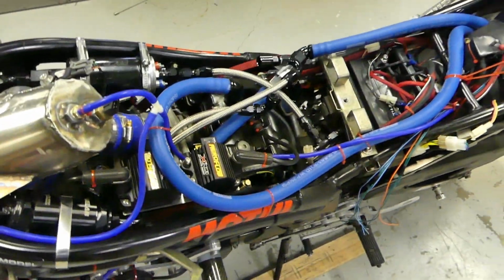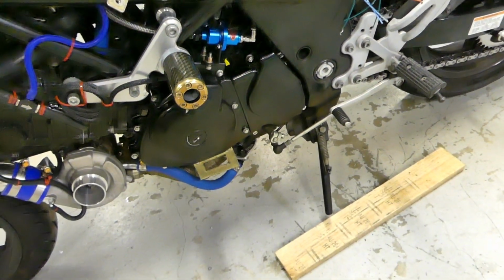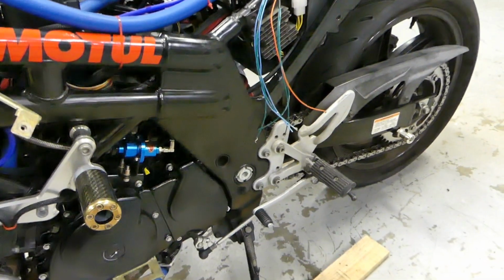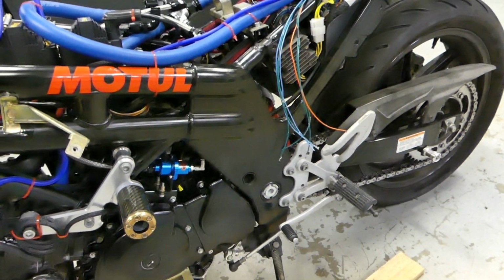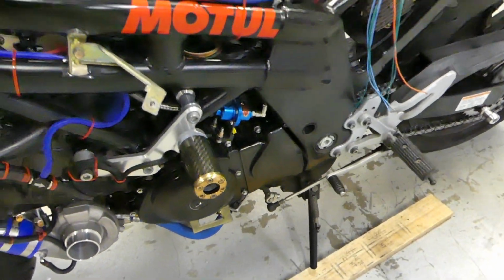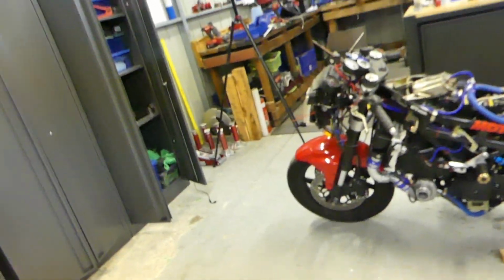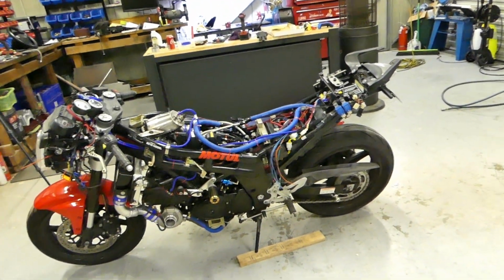Exciting times. One thing I do need to finish, she's got a bit of weight to it now though, I'll tell you that much. The foot on the stand, I've got to weld it back on. I was going to run 2-inch lowering dog bones, and it set the bike a little bit too low for my liking, so I'm going to grab some 1-inch dog bones. And I think with the 1-inch, if I just weld the foot back on as it was, it should be sweet, but, you know, she's got a bit of a lean to her now without it, so yeah, I'll get that back in, chuck some oil in it, and next video for the bike should be at least it's starting, running again.